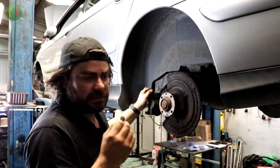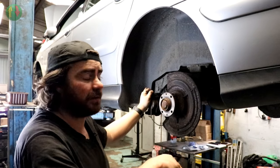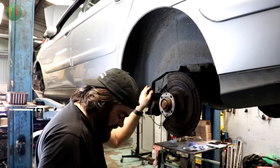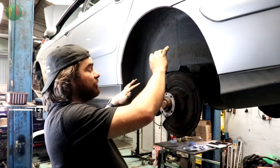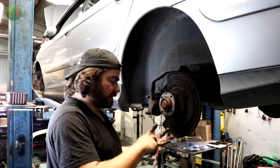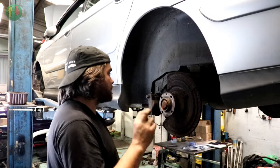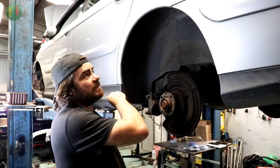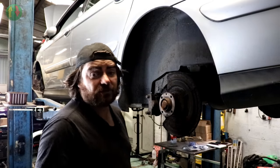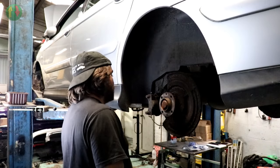I think they are. Citroëns normally have their own little funny unions with funny sizes, but that's with LHM cars. LHM cars don't have conventional flares in the pipes. You'll see plenty of LHM repiping on the SM, don't worry. What I'm thinking is, although this is a hydropneumatic Citroën, it has conventional brakes. It's not an LHM based car where it has a central hydraulic system that powers the brakes and the steering and everything like that. The brakes on this car are completely conventional. I think, and Ian alluded to it in one of his videos, and he's probably right, it's because to get the ESP systems and traction control and electronic brake force and everything like that, they just couldn't have that compatible with an LHM system. Or because people were mincy about it, I don't know, but I imagine that's what it was.